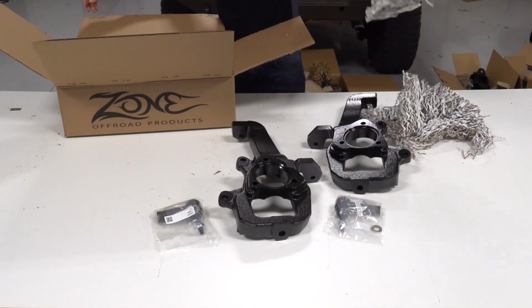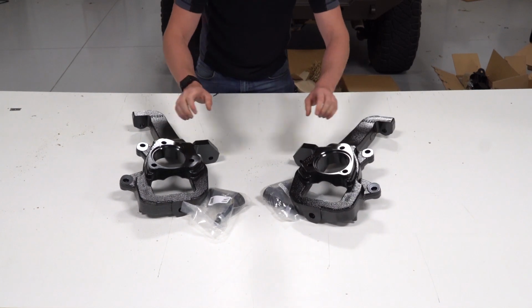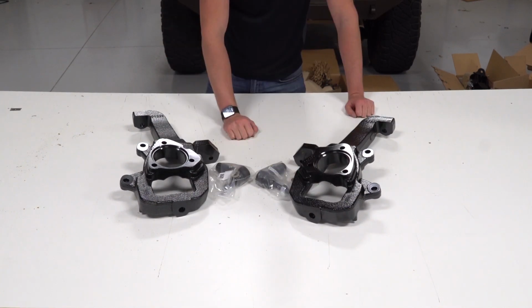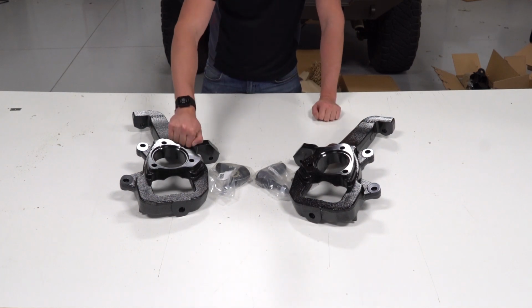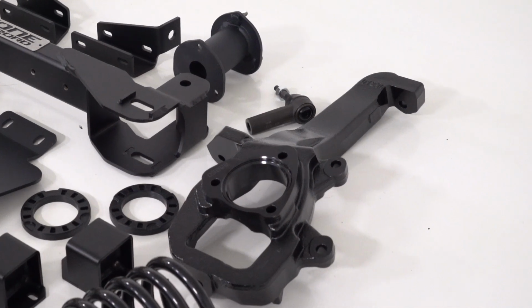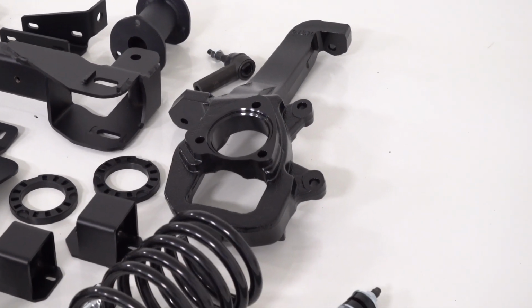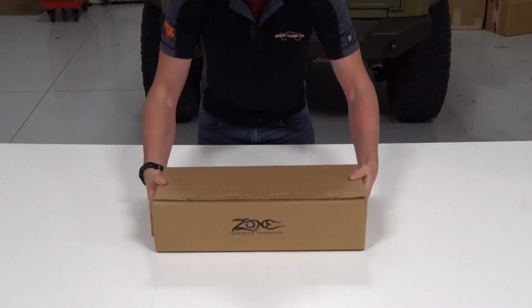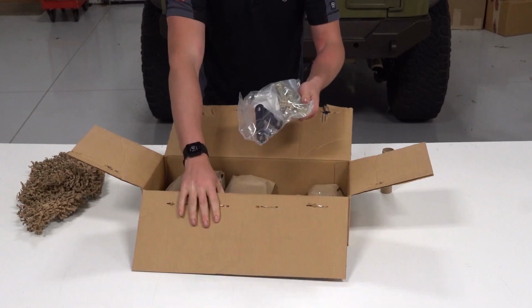These high-strength steering knuckles are solid ductile iron castings that have been CNC machined for an exact fit on the new trucks. These knuckles are much taller than the factory units to connect between the upper A-arm and the newly repositioned lower A-arms. The steering arm mount on these has been moved higher to maintain the factory steering angles for better handling once installed.